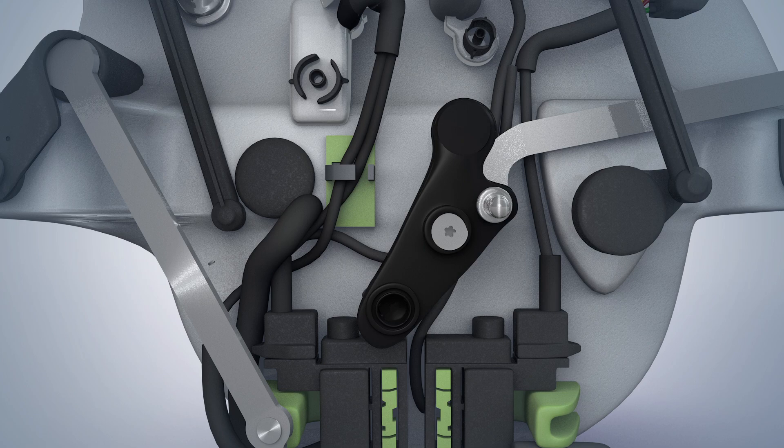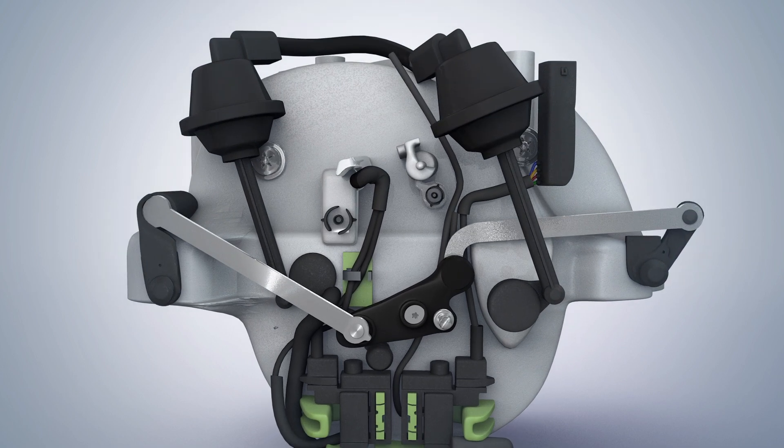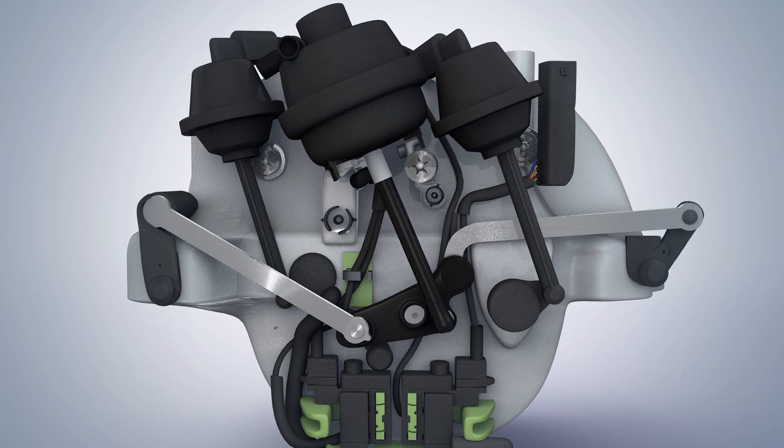Put a small amount of silicone grease onto the ball studs of the right and left connecting levers and snap them into place on the central pivot lever. Install the new Europremium vacuum actuator onto the locating guides and push on the newly provided push nut. Reconnect the vacuum hose to the upper canister body. Lightly grease the central pivot lever ball stud and snap the actuator rod onto it. The newly repaired and upgraded manifold is now ready for reinstallation into the car.